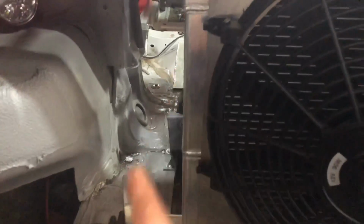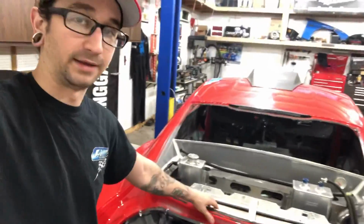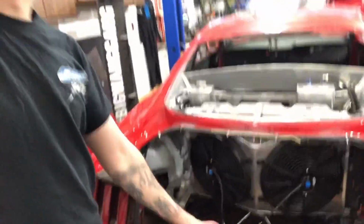So if you're considering doing pusher or puller fans, I'd highly suggest doing a good shroud sealed with puller fans on it. To help out with that, it's always good to make sure that you have your radiator ducted properly and sealed off properly for any incoming airflow as well. You can see next to the radiator, I do have some plates put up, like a little shield put up right there. You can see it right down there. Sides not on there right now, but you can see where the piece actually bolts on up in there. Oh, hey, there's that light. I was looking for that. Right there, and then there's another bracket up top here where it bolts on. It creates kind of a funneling effect to any air coming in through the ducts or through the top. It'll want to push it right through the radiator and follow that low pressure current into the air box and out the back of the fans and then out the back of the car.